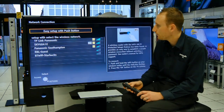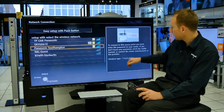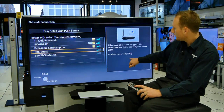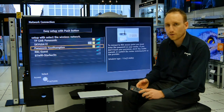It may be Sky or BT Home Hub, for example. We've actually got a couple on here, and one thing worth noting is that we have a much better success rate if you use the wireless type 2.4. Some people have 5 gigahertz routers — if you have the choice of two, we recommend using the 2.4 gigahertz frequency.